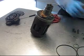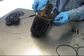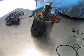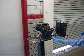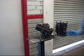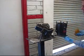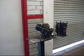Now you can see we have an exposed groove for our O-rings. Take one of the case O-rings, lubricate it very well, and set it into that gap — make sure it just sits in there. To assemble the compressor, the best thing to do is take a piece of scrap steel and make a bracket to hang the compressor from a vise. Let gravity do the work for you. It's very easy to cut a seal on these, and this is the main reason why most people shy away from doing an A6 — but it's not difficult as long as you hang it like this. Take some oil and lubricate all the way around the inside so that the O-rings have something to slip on. Also lubricate the O-ring on the cartridge of the compressor itself as well.